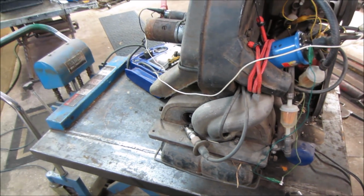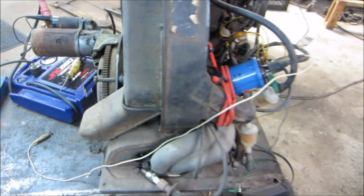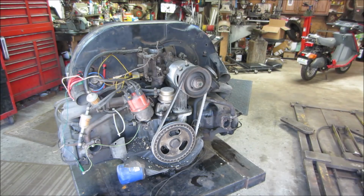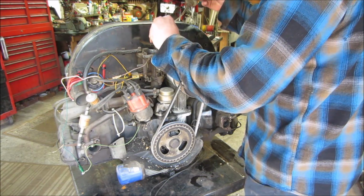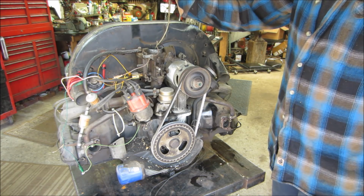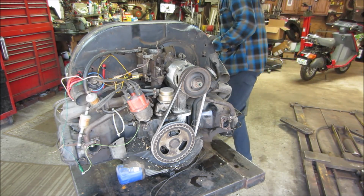Let's go put that back in. You kind of want to make sure you disconnect it between cranks because it will burn up the points on you. We need fuel. I'm going to put that back in and see if we can trickle some gas in her and fire her up. All right, let's go give her some gas, a little for that. And then we're going to try to put some in the float bowl. Probably save a hair if you need to go fire it again.